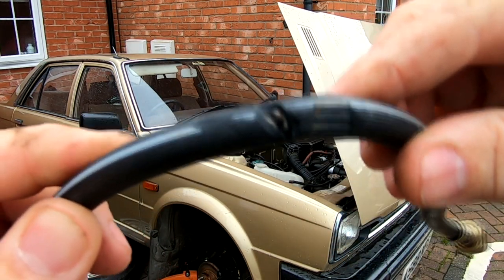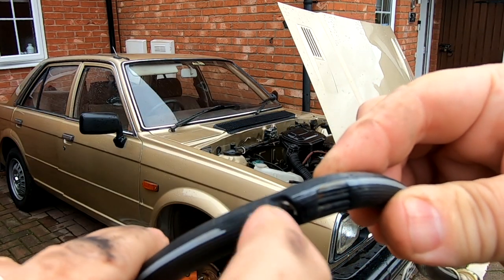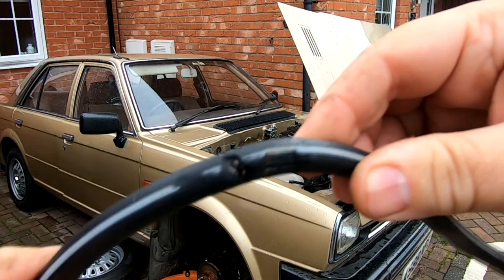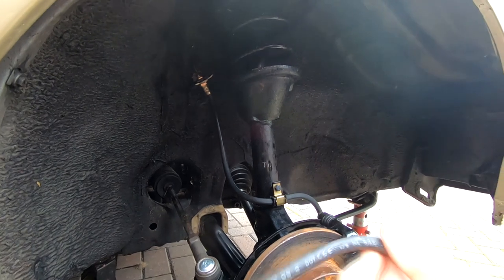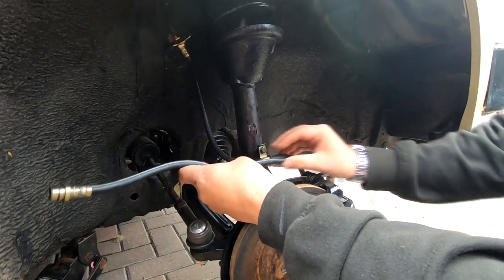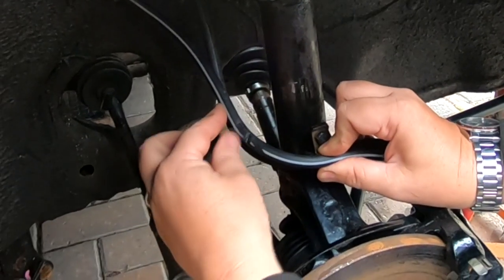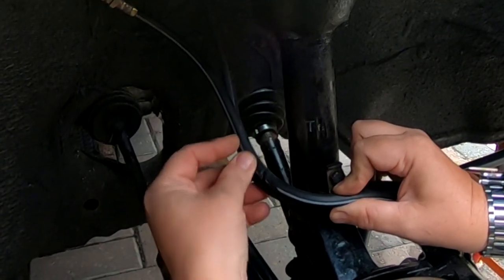Can you see that? I don't think it's a slice — it looks like a sort of a wear mark, which I find very strange. It's gone right through. Let me show you where that wear mark actually is. So this is the new hose which I've put in situ now. If I show you where that actual mark was — that went that way around, so that would have been on there like that. There's the clamp which sits there, and that goes up to there. Can you see where that mark is? Right there — that's where the slot is. And there's nothing there, nothing whatsoever that would cause that to rub in this area. The wheel's not in the way, there's nothing else in the steering there. And that is actually where the slice was, right there.